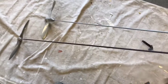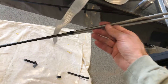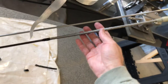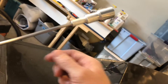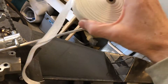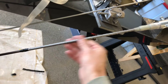I can get through a full 24-hour period — 250-some kilometers — on this shaft before it will break, but you never know when it's going to break. From experience, we've found that most likely the shaft breaks up near the top. So what we started doing is bonding the shaft right into the coupler with epoxy and then wrapping fiberglass around the shaft and the coupler. This adds a lot of extra strength right where there is the most stress.